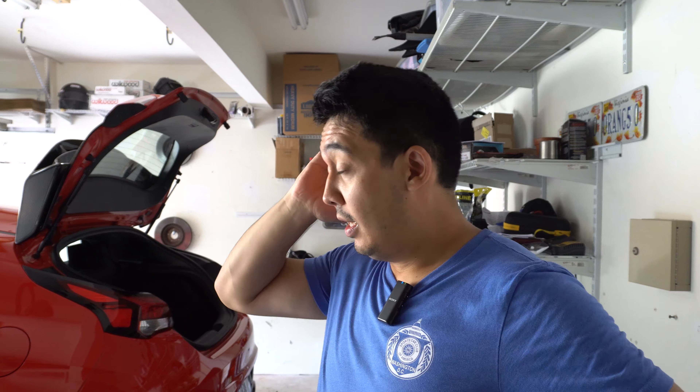I'm super happy to have this kit — it's a big upgrade. As far as wheel clearance, my Koenig Ampliforms clear fine with no problem. My daily wheels initially didn't clear because the wheel weights were touching the calipers, but after getting them rebalanced they're fine. I've been driving them on the street with no issues, which is great so I can use the GS1 pads on daily wheels without putting miles on my 200 treadwear tires.